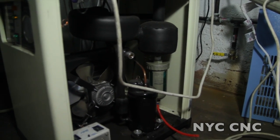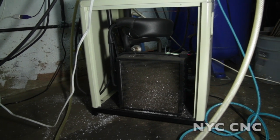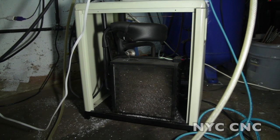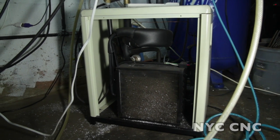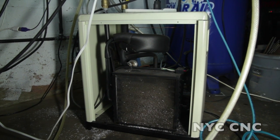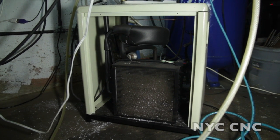Then I started to figure out what the real problem was, and it quickly occurred to me as soon as I opened the other side of the machine and saw the condenser — or what I would think of as the radiator. I instantly knew what the problem was. This is embarrassing — I should have never let it get this dirty. This whole machine works just like a refrigerator, and the air exchange between those radiator coils is incredibly important, so you need to clean that off.